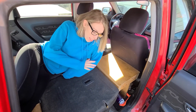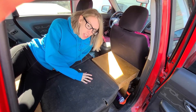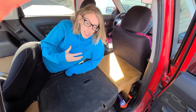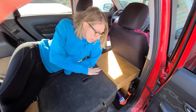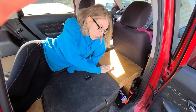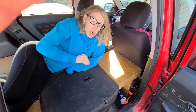One of the questions that Karo had asked is how I handle the fact that this seat, when it's laid down, is at a bit of an angle compared to the rest of the situation. Part of this is that my cushion is thick enough that I don't really notice the incline that much. Additionally, when my body weight is on this seat it lines up with this platform — I measured the height with my weight on the seat so that it's a smoother transition instead of having that sharp incline.